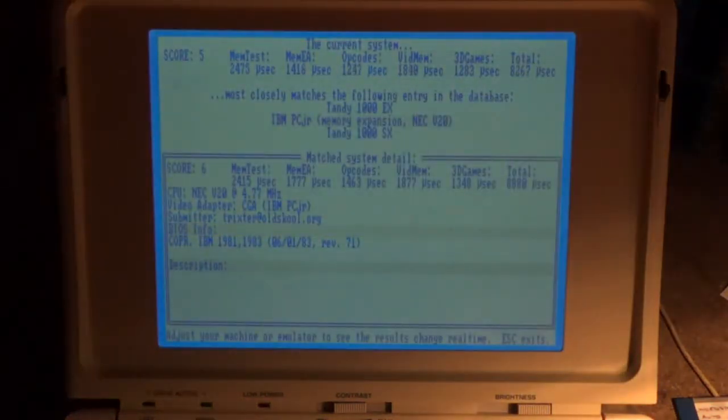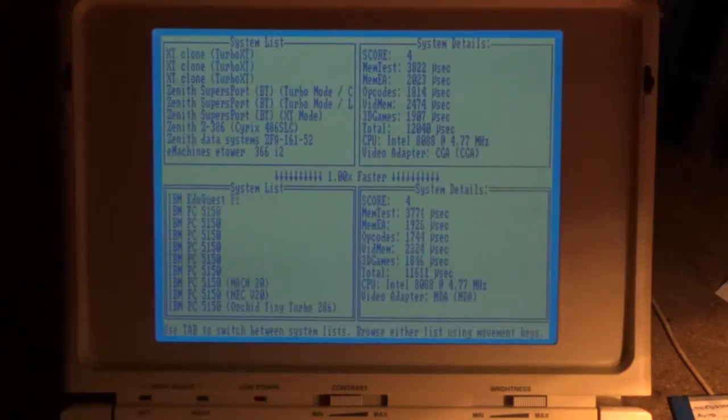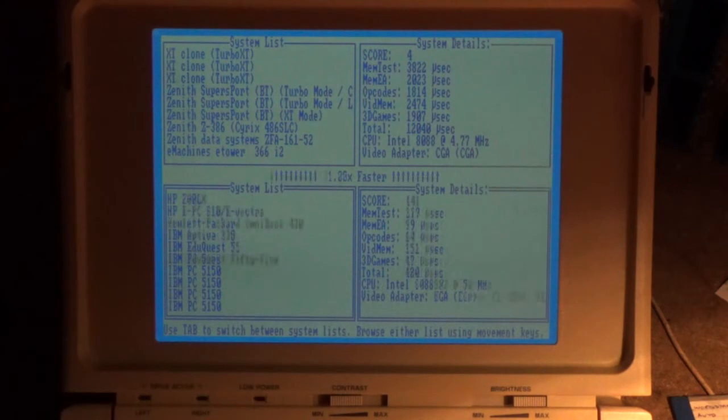The only benchmark we're really going to run on here is Top Bench, and well, yeah, it runs. It seems to score pretty much on par with the real XT, or at least it trades places back and forth. It seems there's a fair bit of variation. Now, if we turn the speed down to 4.77 MHz, we do indeed get 100% IBM 5150 compatibility, which is what that switch is meant for. You know, timing specific applications that just relied on the CPU clock. Supposedly that's 4/3 of the NTSC color burst or something, the CPU frequency. I would imagine that's part of the reason they chose 4.77 back in 1981 or whatever.